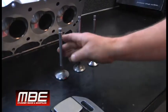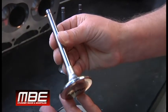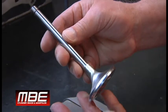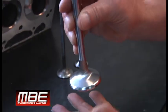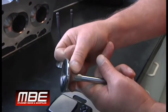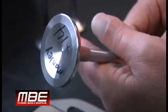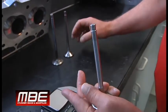You can look at this valve right here — this is an Inconel valve out of a top fuel car, and there's a brand new valve out of a top fuel car. It has a 3/8 stem. The reason why they go to the larger stem is so they can make it bigger down here so it has more mass to dissipate the heat, similar to what we do when we put a two-degree hub on the exhaust side.